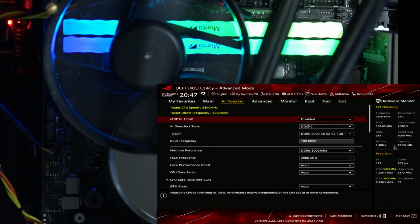I could be wrong about that because I don't remember where I read it, but AMD is using a Synopsys design for DDR5-8000. As far as I know, that should be what they're using. Yeah, but then you look at my 9950X and it very much does not do DDR5-8000 at all, even though in 1-to-1 mode it seems to be the strongest CPU I have. So obviously you have the silicon lottery with the CPU. Some CPUs will do DDR5-8000, others just won't.